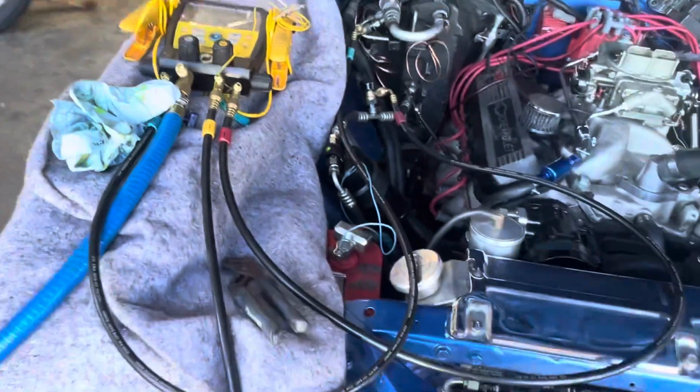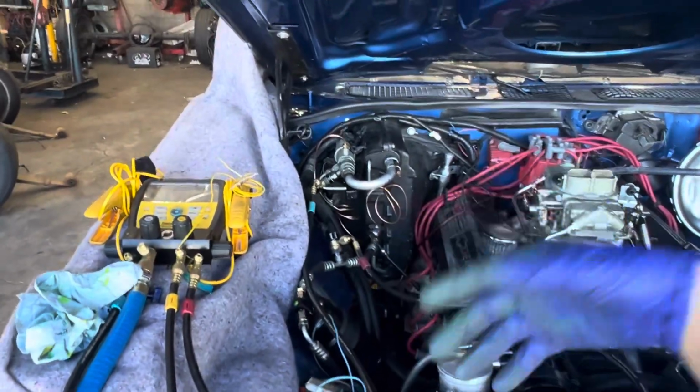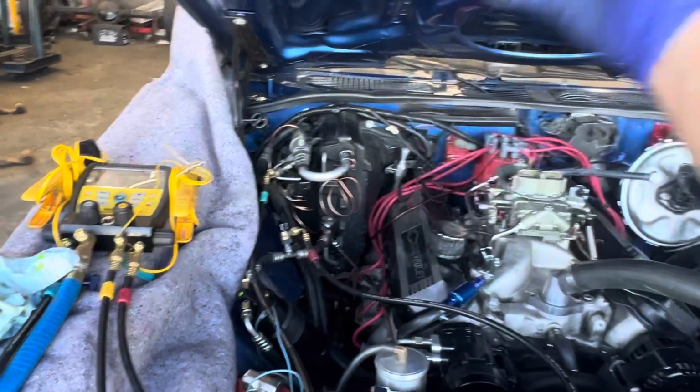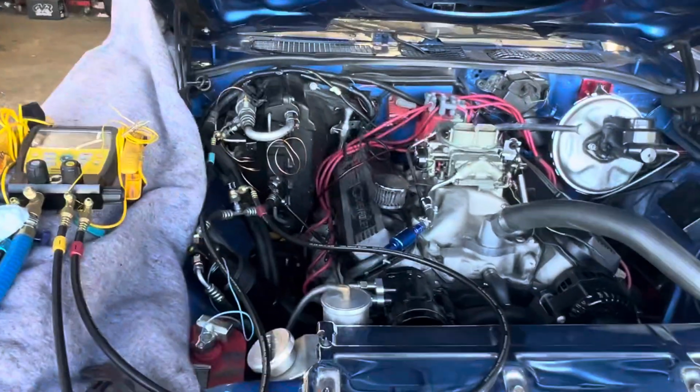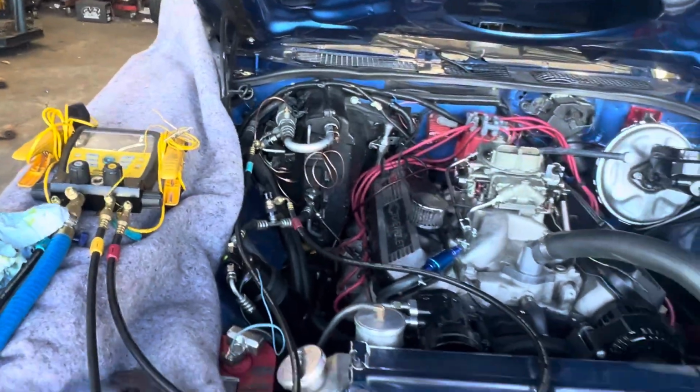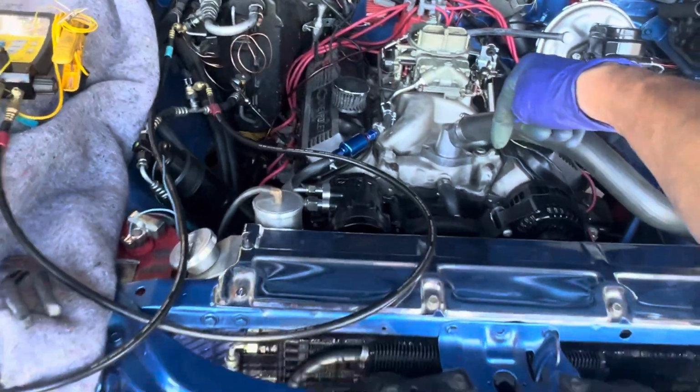They get rid of the receiver. And a lot of times they just misdiagnosed. They go, oh, my expansion valve is plugged up because it's going up to 250 or 300 PSI. And that was on a cold day yesterday. If it was a hot day, the high side probably would have gone to 350 PSI. And especially if it had a thermal fluid fan clutch.